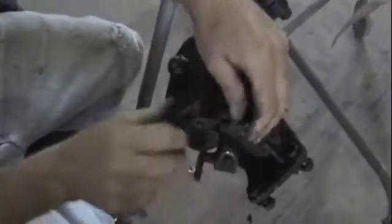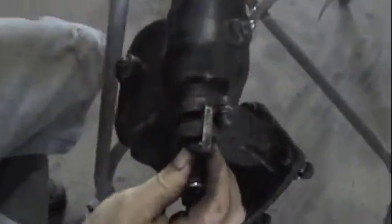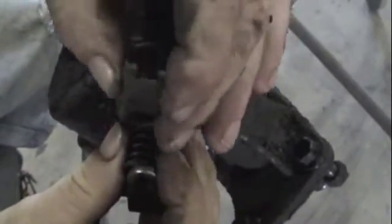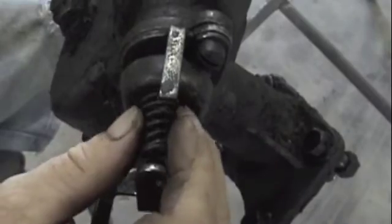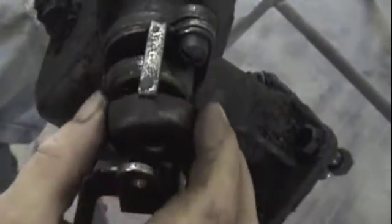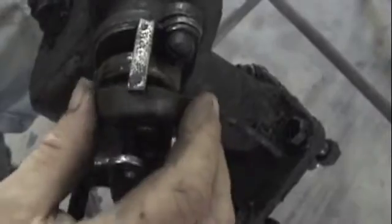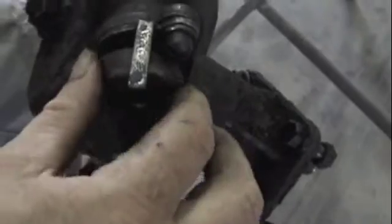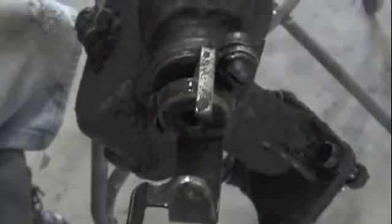Alright, taking the 31 column apart. We got these pieces here. I'm gonna pull that out. And then we got a lever here. It goes in first between the spring. So what we have is spring, lever, another lever. Then we have a plate. Ring plate, and right there it sits into a spot, so it's between those two. And that is it for taking that section apart.